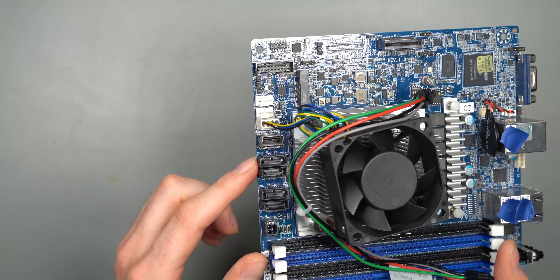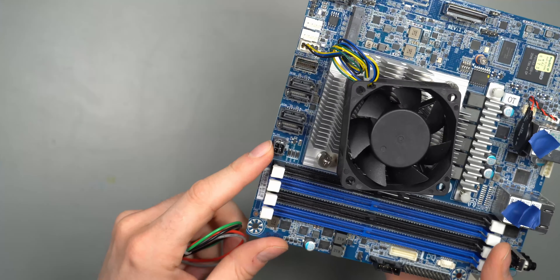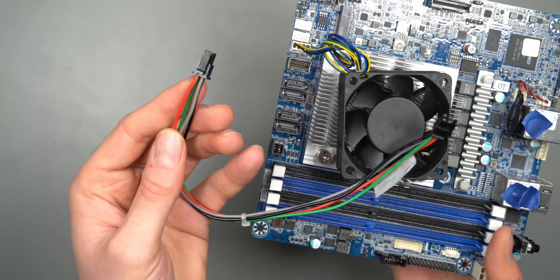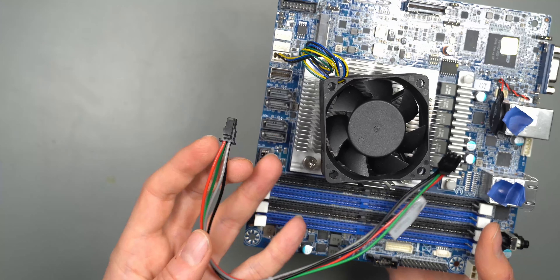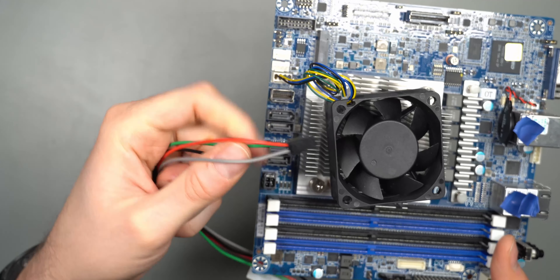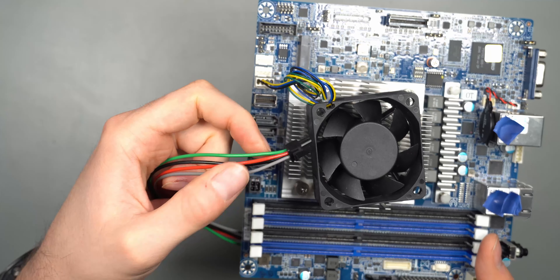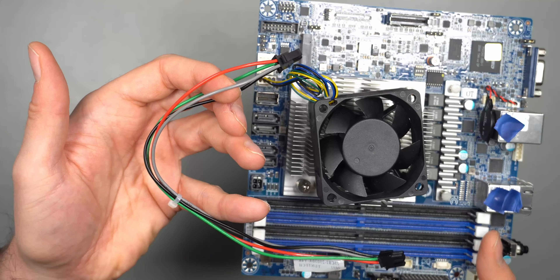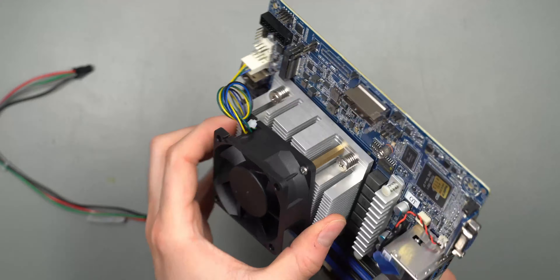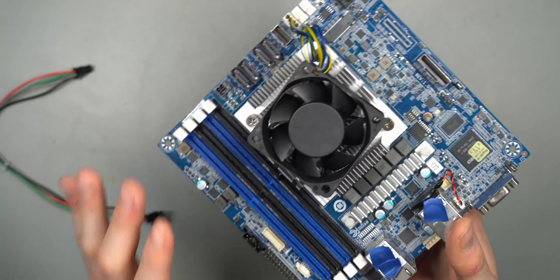In this video we're looking at the non-zero variant, revision 1.0. The main physical difference is the SlimSAS 8i port, which runs PCIe x8. Unfortunately you cannot bifurcate or split that up in the BIOS — x8 is the only option. It would have been nice to split it to 2x4 for instance, so you could run two NVMe SSDs there. We also have a 4i SlimSAS port, which is PCIe x4 but can also be adapted to use four SATA ports — so you can actually run up to eight SATA ports from this motherboard.